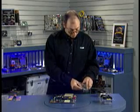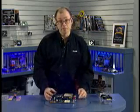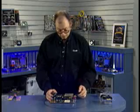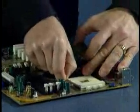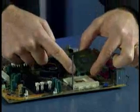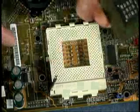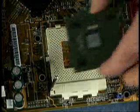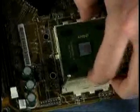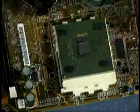I'm going to take it out of the package. Just like with the Pentium 4, this is a zero insertion force socket, so we've got this lever that I'm going to raise up. Lifting this lever releases the grip on the pins on the chip. I need to find pin 1, which on the Athlon is indicated by a gold-colored triangle — you can also see it on the bottom, and there's a missing pin in that corner. Align that with pin 1 on the socket, then simply drop the processor in, hold it down, and push the lever down. Now the processor is firmly installed in the socket.